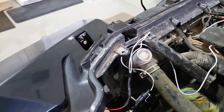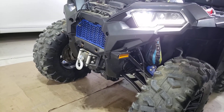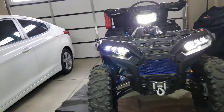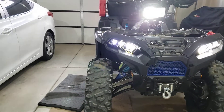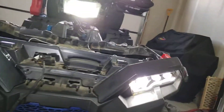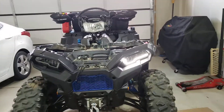I wanted the drive light option. Here I'll show you low beam and then high beam — that'll give you low and high on both sides. That little red wire gives you your drive light. If you don't want your drive light, you don't have to do it — just leave that unplugged and you don't have to wire anything in. So it is plug and play; it plugs into everything.